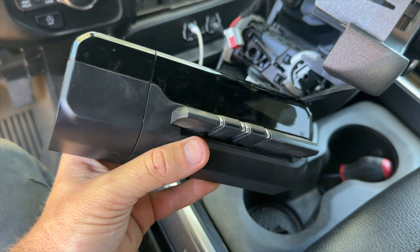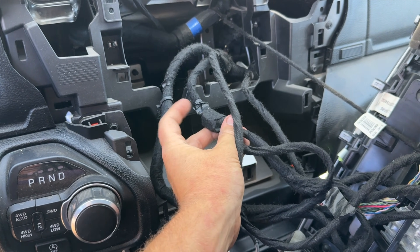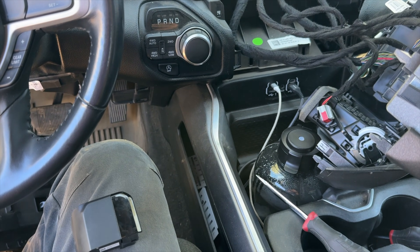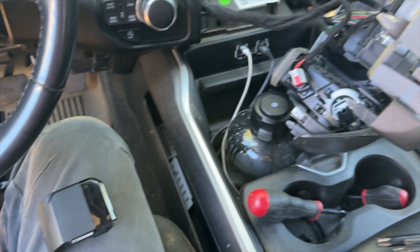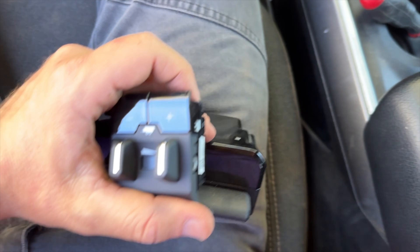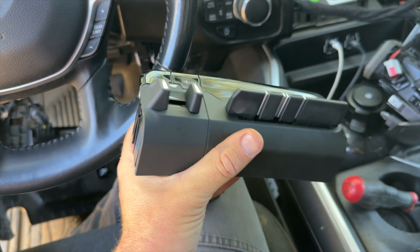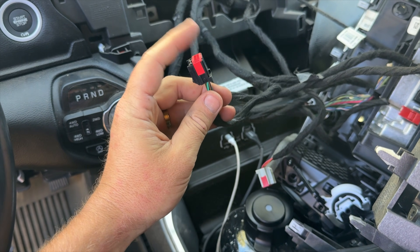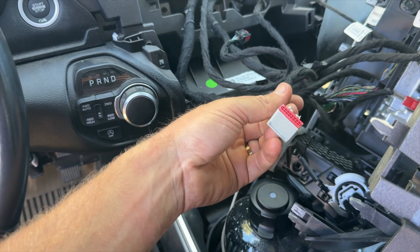Now that we have this out, we remove the blank and install the OEM brake controller. There should be a dead-ended wire somewhere in this mess — a pigtail that will plug into the brake controller. To remove the blank piece I used a flat head screwdriver to pry the plastic clips — there are clips on top and bottom. That piece pops out and we grab our new piece, the OEM controller, plug it in right here, and it snaps in place. Then we locate the trailer brake pigtail and the traction control and tow haul switch pigtails and plug them all back in.